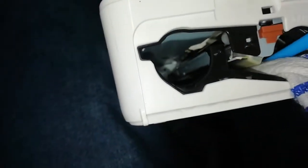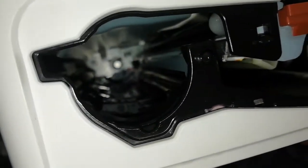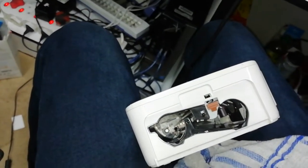You see, I use this, so you press against it, those things, you clean them, you come inside here, you can see that. I'm going to show you two things also, where your paper passes. You see those two, these ones here, these two. The camera can't capture it, okay, I'm going to show you. Yeah, you can see those two stainless tubes, but they are metal. You put your cloth there, you start rubbing it, get something, because it's difficult to go in there with a hand. And another thing, I don't advise you to open it, because when you open it, you might not get it right to assemble it. But if you manage to open it, then you're going to have to clean here yourself. You get me? You're going to have to clean those and clean also the rollers nicely. These two rollers, you can see these ones.